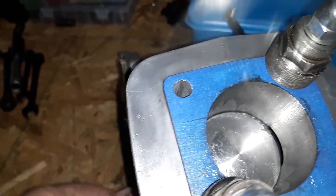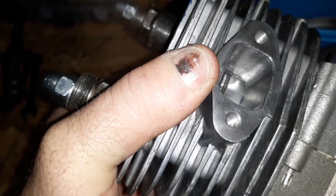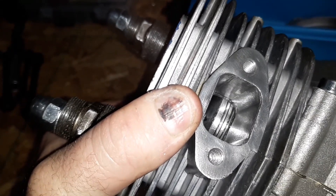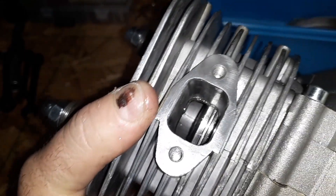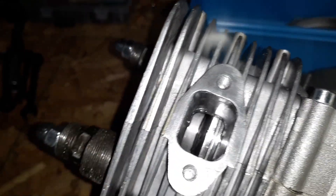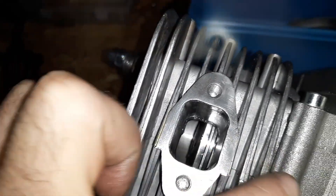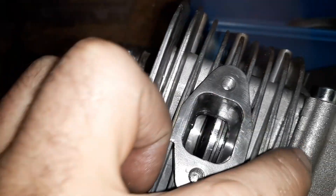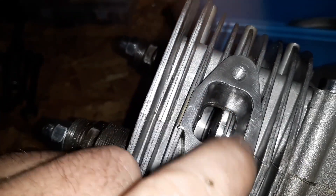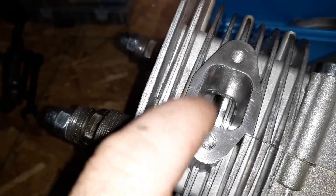Here's our exhaust port — the next big one. That's bottom dead center right there. We're missing one third of this exhaust port. If that crank was the correct height — a 40 millimeter stroke — we'd add three millimeters that way. The spacer would bring this up three millimeters, plus 1.6 for the gasket, and in the CAD drawing it comes out 0.7 millimeters under the exhaust port at the top.